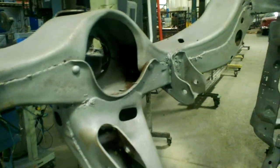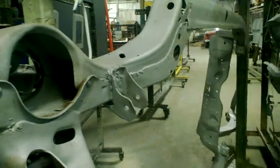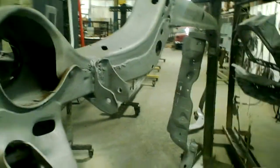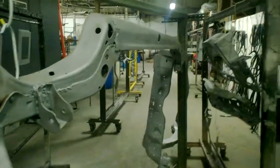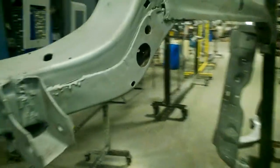The way we'll do it is: we'll powder coat it cold electrostatically first — that gets 90% of it — then we'll put it in the oven and get it hot. Then we'll take it out and powder coat it again hot, and then you've got a show car quality frame.